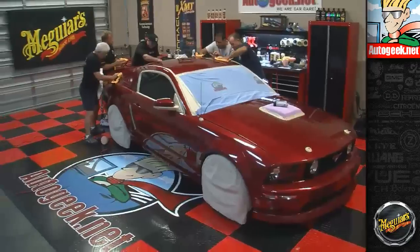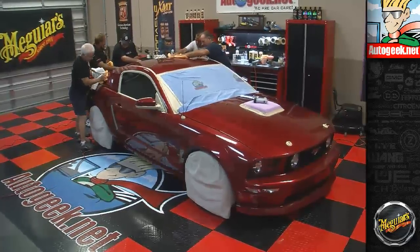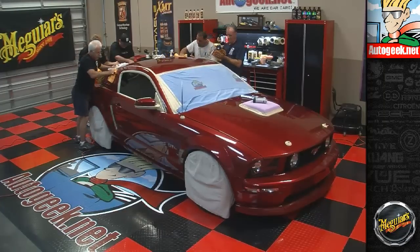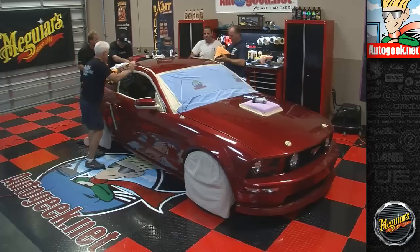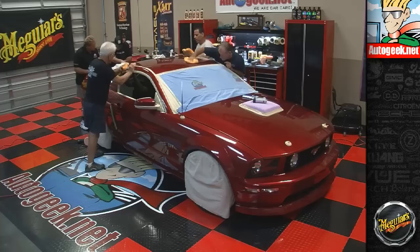That looks pretty good. One thing I'd say is you're running that pad over the edge. It's a good best practice to not buff on the edge. But nice slow arm speed. The pad's rotating. Bring your pressure up just a little bit. Get a little more. There you go. A little more rotating speed. You want to see it rotating at a fairly quick flip. Beautiful, man.